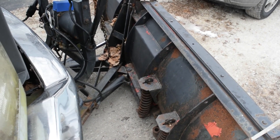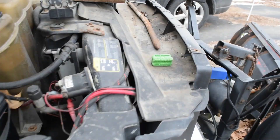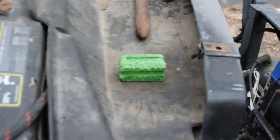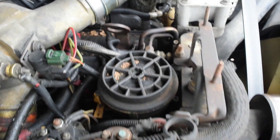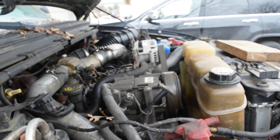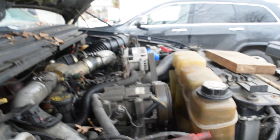Like I mentioned, this is a plow truck so it sits most of the time — usually out in my backyard. The first time I encountered this situation was on a truck that was driven quite frequently. With this thing sitting all the time, I've got these little bait blocks in the cab and underneath the hood. As you can see, that one's been chewed on. Even when you offer these critters stuff to eat, a lot of times they bring their own food. If you're having this issue where your alternator is not charging and you don't have a battery light coming on when you turn the key — it should go off once the truck is running — but it will not come back on even though your alternator isn't charging, here's what to check.